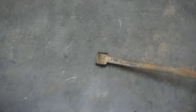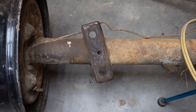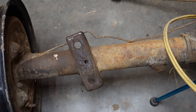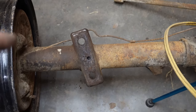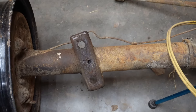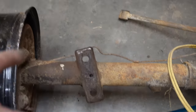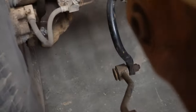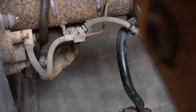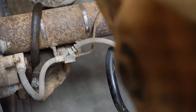On the Chevys, you can see that the spring pad is at an angle. That's the angle the trailing arms are at. Those are aftermarket items. I welded those on my 71. My 71 has a square body rear end in it, and so I just ordered those online. I don't remember how much they are, but they're not very expensive. So I need to order a set of those pads and cut that Ford pad off there and put that trailing arm pad on there. At that point, this thing will be bolted up.